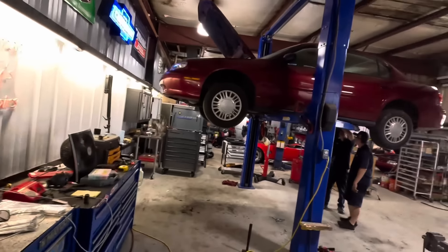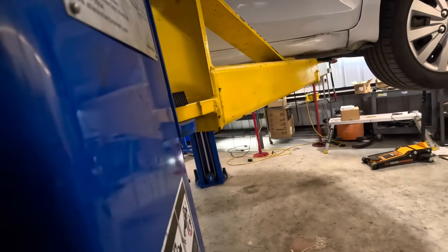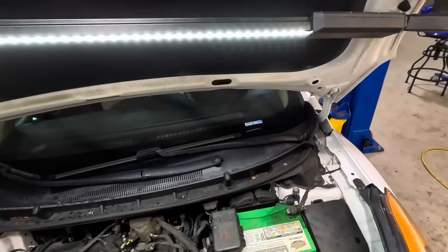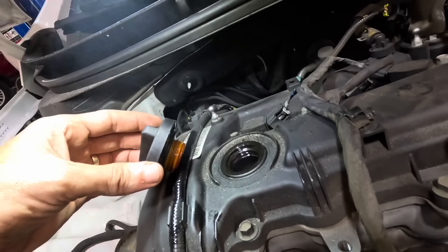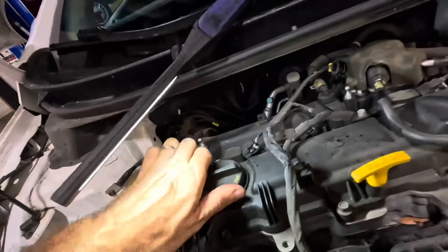I've seen enough — we're not leaking out, which means the oil is being burnt. Let's let her down again. The Hyundai has landed. She's still running. Back up in the engine compartment area. Let me shut down the illuminator bar. I think we're burning oil. I'm going to pull this cap off — I saw some smoke last time. Yeah, with the light there you can really see it — this thing's flinging oil up everywhere out of the combustion chamber. Not okay. We've got a blow-by situation.